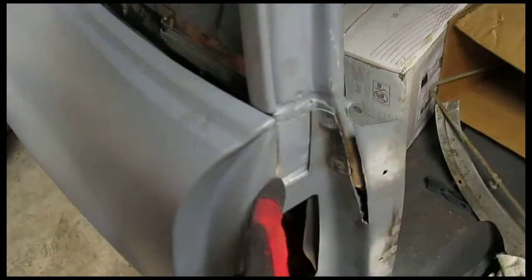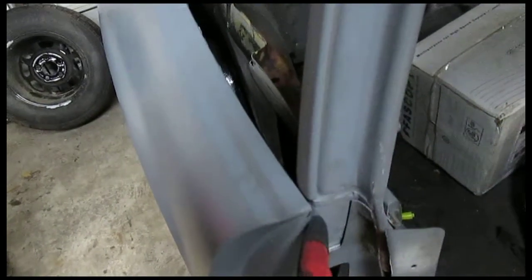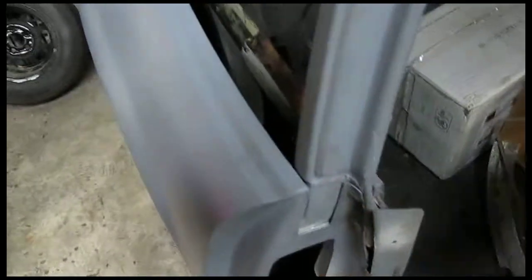And this also is another post car. These two things: this is the vent, which you see in even the F bodies and stuff. My other panel on the driver's side doesn't have that, and then this piece here is obviously for the window to creep forward when you don't have it post, and obviously on the factory side this is filled as well. So, minor things. I had to use the bracing, this inner brace, which actually runs all the way up and inside to here. I cut that off the old panel as well and kept that. That was stuff they obviously didn't include. And yeah, just keep plugging away and see where I get.